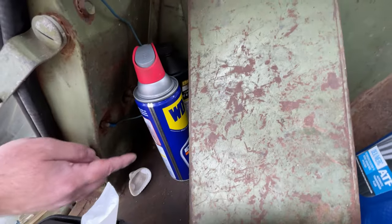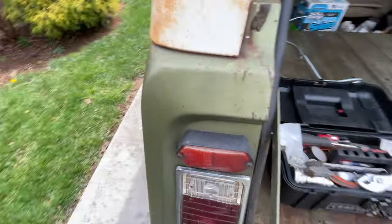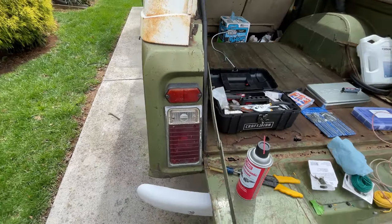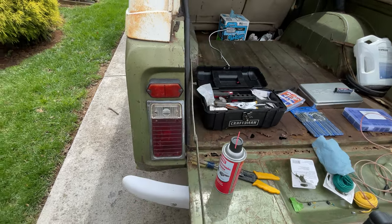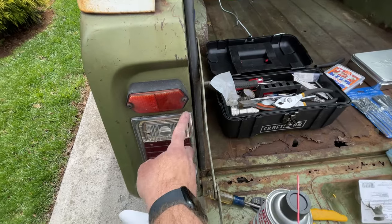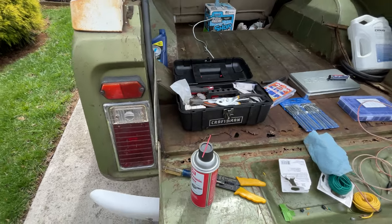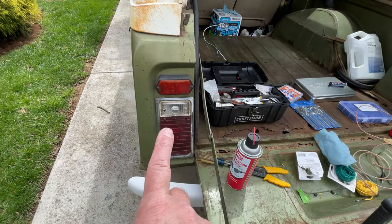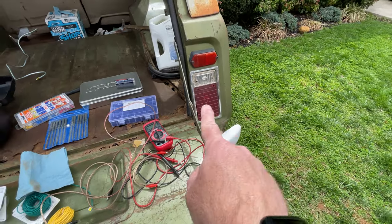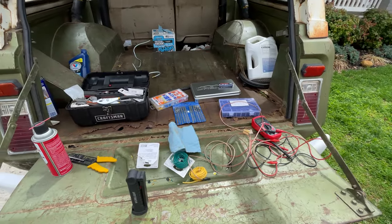On this side, the way it sends power over - there's a double tap going into the connector and it sends power into this lamp and also sends power over to there, so there's probably just a crusty connector. But I'm not going to dig into this right now - it requires taking out a bolt, there's another one over there, there's a broken stud down there and I don't want to push my luck with these until I'm ready to refurbish them. You can buy new lenses, pigtails, and gaskets for these but you cannot buy the buckets - the actual bucket and chrome pieces I've seen but not unless you find them on eBay. So I'm glad having one light - one light's good enough for now. I know everything works, it's just a matter of figuring out this connection.